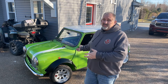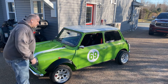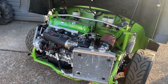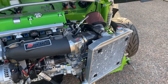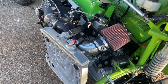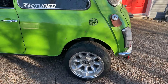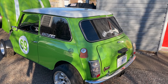In case you can't tell, this car isn't very stock. Let's take a couple minutes and I'll go through what we have going on here. This classic Mini Cooper is sporting a Honda K-series swap. The engine is a K20 from a Civic Si, upgraded with a camshaft, intake, throttle body, custom header, and a custom stainless three-inch exhaust. The wheels are a set of Mini Lights — 13s with street slicks. The ECU is on an Hondata unit, wiring by K-Tuned. Brakes are Wilwood all the way around and the suspension is a set of QA1 coilovers. All of this is mounted in with a set of custom subframes from a company called Mini Tech, also known as Super Fast Minis.